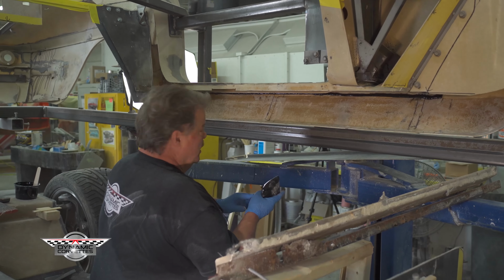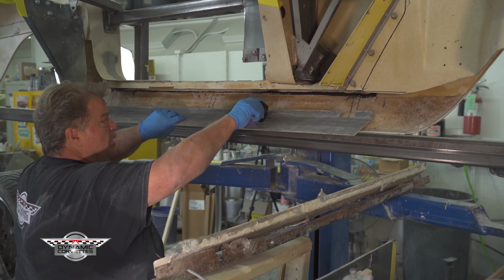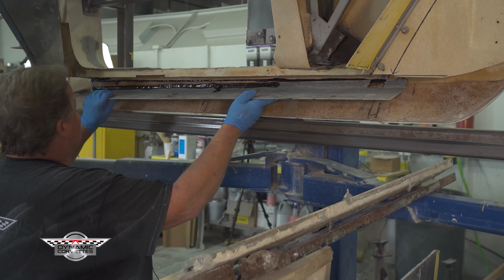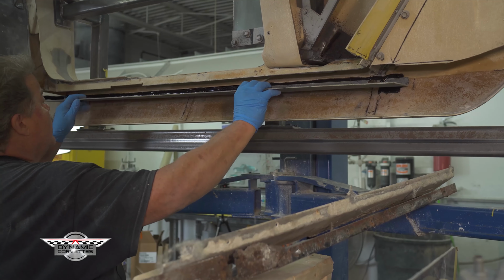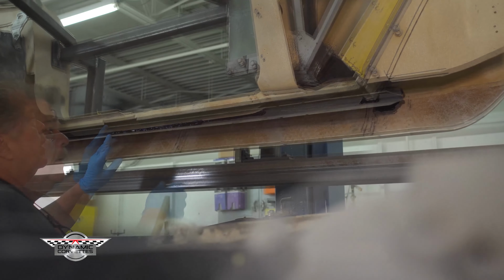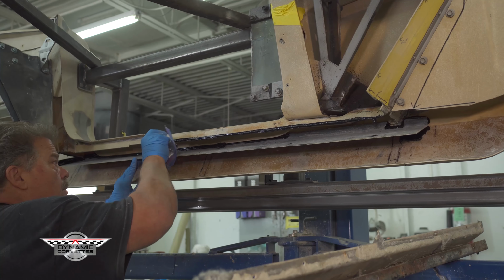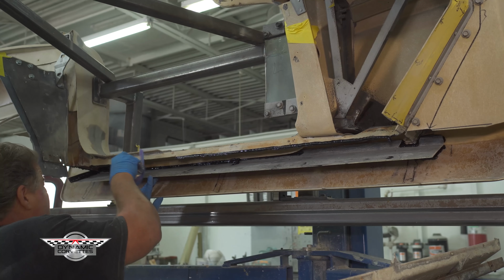It's a pretty easy way we found to deal with our epoxy. We mix up what we want. We don't get carried away with mixing up any more than we have to. Sometimes you do, but versus a cartridge, you get pretty good after a while. Now this panel is locking in, and with epoxy, we always like using epoxy for almost everything. This panel's getting locked in there. We're just going to run a little bead right along here because we have another panel that after this is all bonded is going to get bonded in here. Another nice thing about a baggie, it'll go places that those cartridges won't.